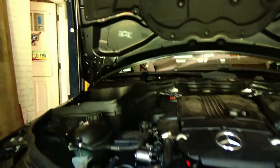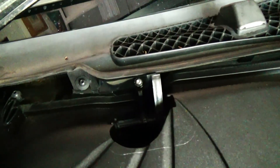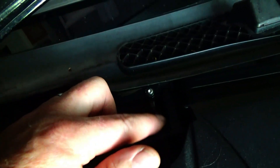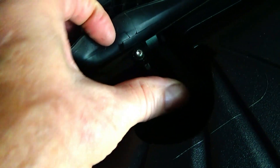If you've got one of these Mercedes W204s or similar and someone has come in and removed the air box without knowing how to do it and ended up breaking the clip, you can fix it with a zip tie — a mountable zip tie and a screw — just like that. It's very easy and it's actually more secure. From then on you just use a Torx screw to get the air box back off. I'll show you what I use here to do it.